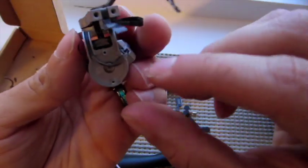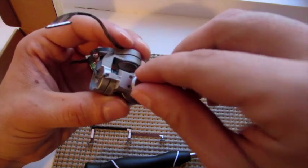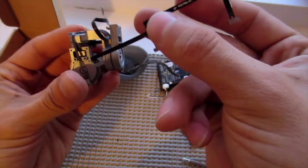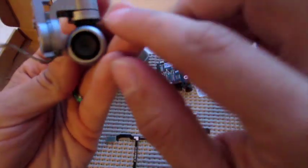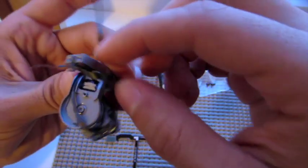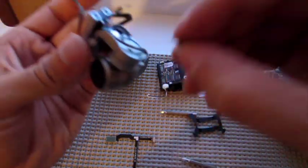We're getting more of the ribbon gimbal exposed so we can work on it and replace it. Next I'm going to take these two screws out to remove this cover. You can see the path of the ribbon cable — there is an adhesive attachment right here, and on my new ribbon cable you can see this is where that goes. It wraps around this gimbal and comes out the other side, loops the other way, runs along the back of this piece, comes out the top, loops forward, and branches off into two sections — one goes up, the other goes down. This is where my cable got severed.